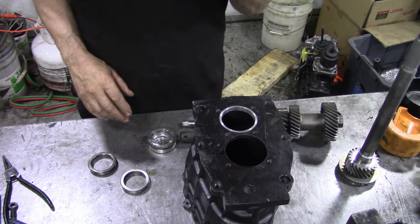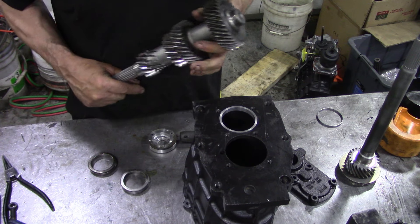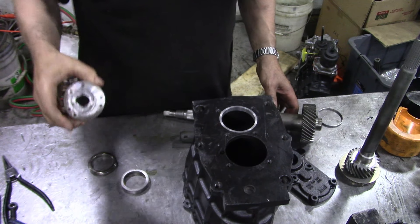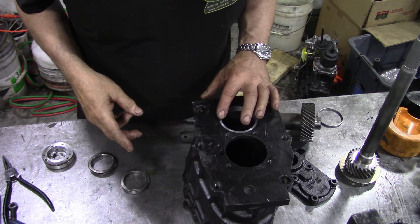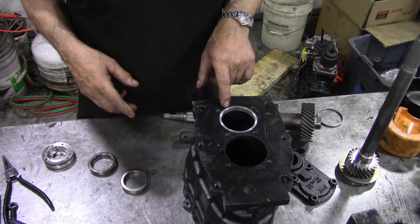R380. Now this one I'm going to put together is out of a TD5 that came from Ontario that was really bad - it was all busted up. The casing was damaged, this front cover was damaged, the lay shaft finished, and these were pretty expensive parts. That's the state of the oil pump - it was absolutely knackered. But I've got a few spare parts and JP and I put our heads together and said, can we salvage this casing? And he said yes.